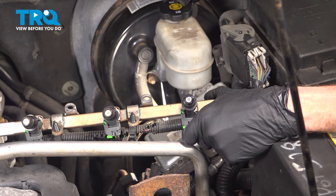Start removing the tape from this area. The next thing you want to do is clean and inspect the mounting area where your intake manifold will go. Give it a quick wipe with a rag that has some parts cleaner on it. If you found raised areas, use a sanding block with some very fine sandpaper — we don't want to mar anything, just try to remove any discrepancies. Before we put the intake in place against the engine, it's important to make sure that you clean and inspect your gaskets — make sure they're all soft and pliable and not torn, worn, cracked, or damaged in any way.